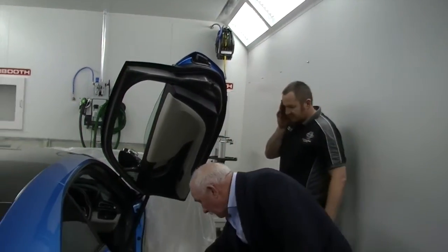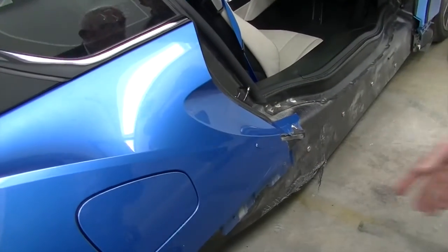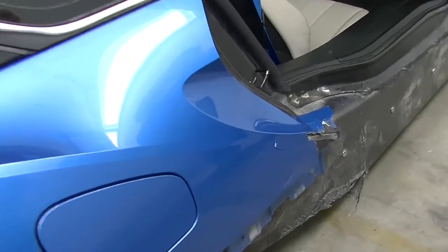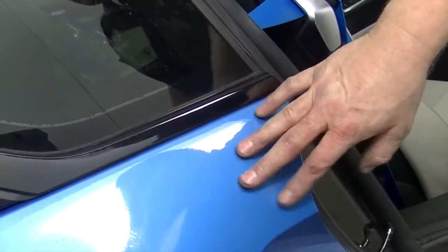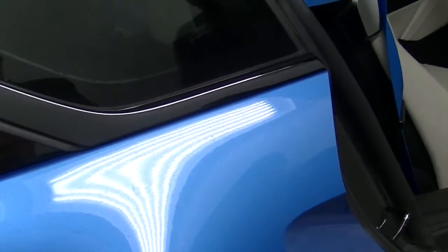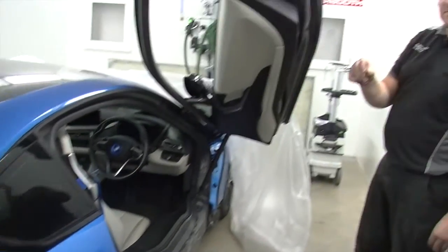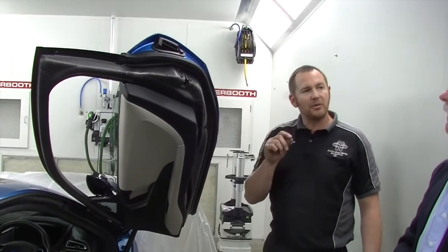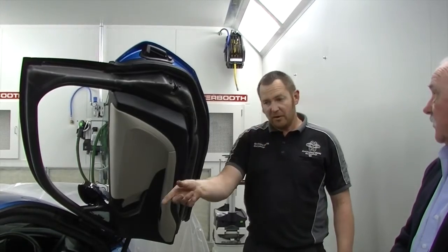Is this an example of the bonding of this panel to a brace? Yeah, it's just a brace. Most of this will actually be bolted on — that's all bolted in the quarter. But when you replace the bolts, even the bolts have to be done to a certain torque. If not, you can just shear the bolt through the carbon fiber.